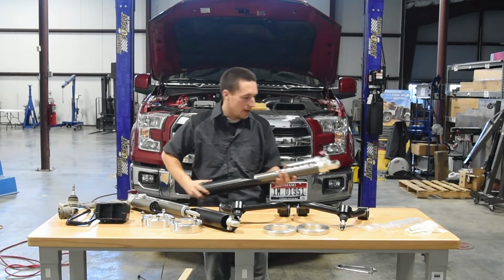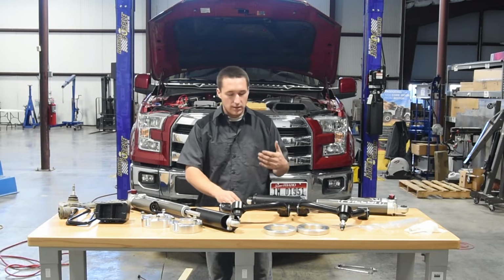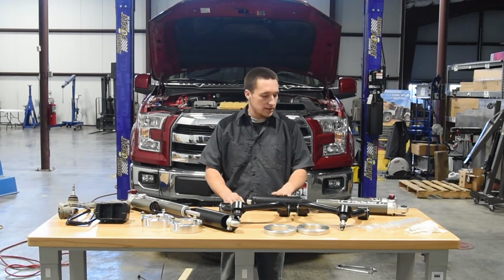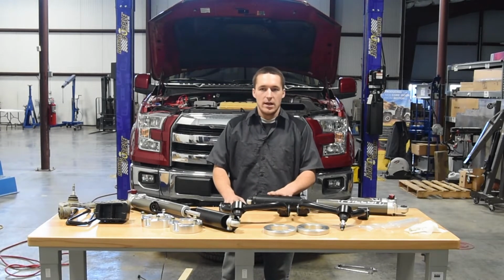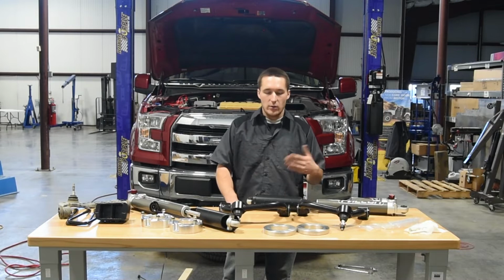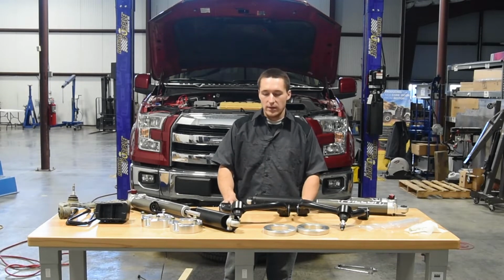And this truck behind me here, it's my personal rig. I've got a side-by-side that I haul, I've got a boat that I haul, and these are going to perform flawlessly for those reasons. And then for the front struts, it's actually got different circlip areas that you can adjust your ride height on. So if I want to just be leveled, if I've got heavy bumpers on the front, heavy accessories, I've got a higher clip I can put in for that, which is a really neat feature.